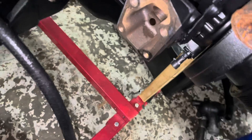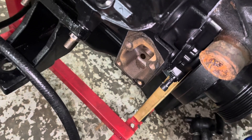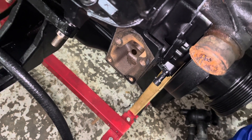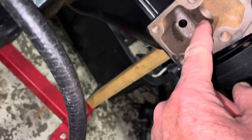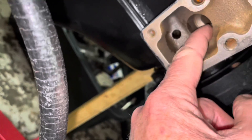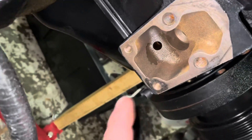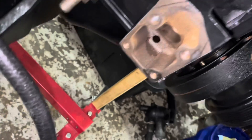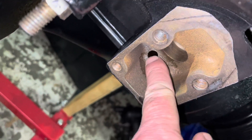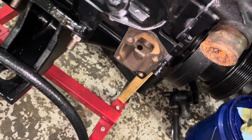This block is a late-80s roller block, made in 1987 and later, but it's pre-fuel-injection. The fuel injection blocks didn't drill these holes here. This hole was for the actuator rod that came off your camshaft and moved your mechanical fuel pump lever — a heavy-duty rod that went back and forth. This other hole was oiled in this area to drain back down into the oil pan.